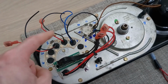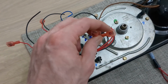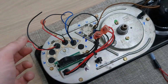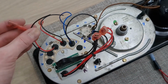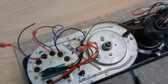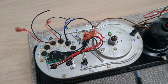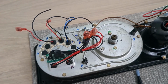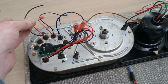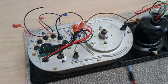The black wire that originally went on here to provide 12 volts, or I guess I can also take it off of my ignition common here, either way, it's just 12 volts when the ignition's on, will then go to here. And I tried this out in the car and it seemed to fix the problem, except for one thing. It still seemed to make everything blink too fast. So it looks like we'll still have an issue when you retrofit, even from the dash light. I'll still have to add a resistor to it.